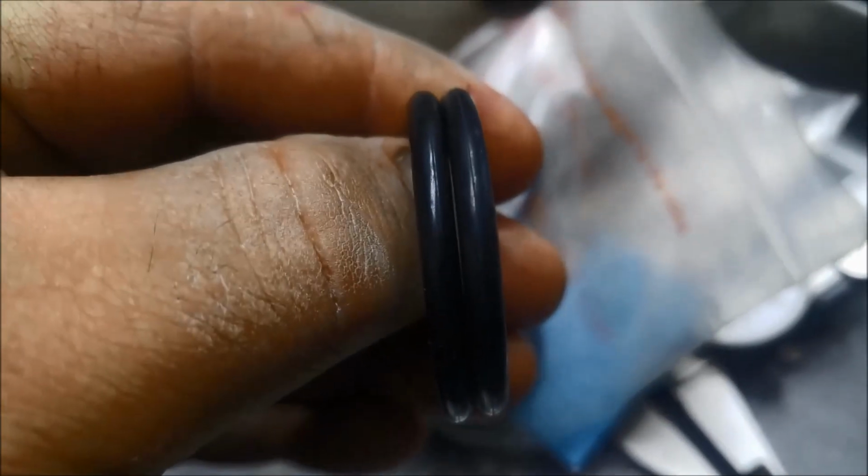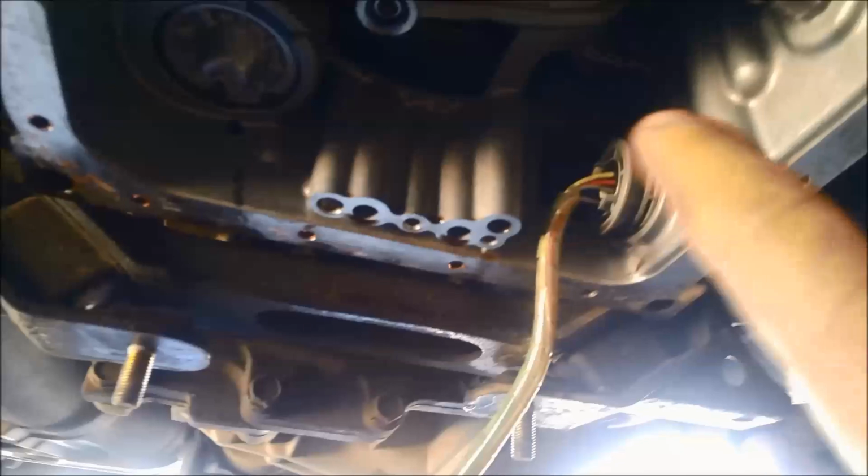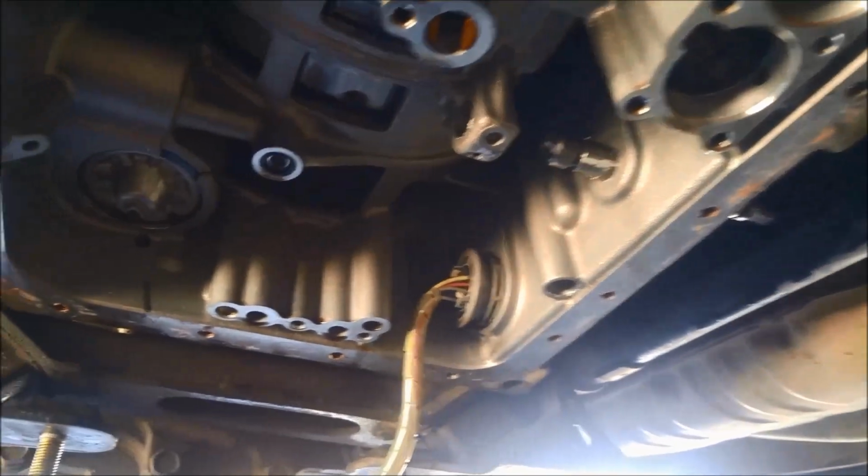Just try and line up top and bottom. It'll actually stretch. When it stretches, it'll thin out a little bit. And before I put it on, I'm just going to give around the plug a good blowout, inside and outside. You don't want any muck getting caught in there and causing a leak later. It's a pretty big job to get to it again. Got the new seal in, and you can feel it. It is a little bit raised.